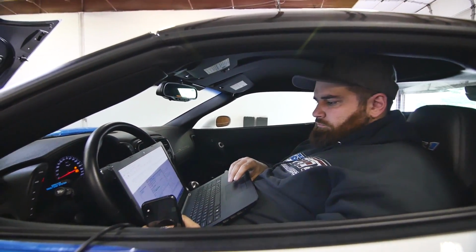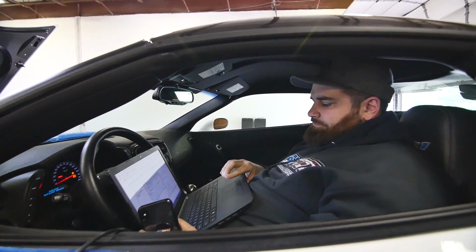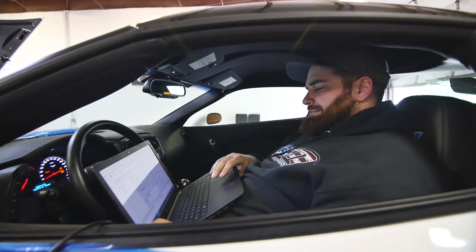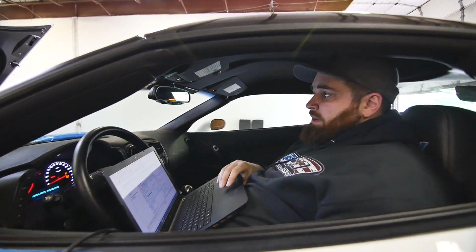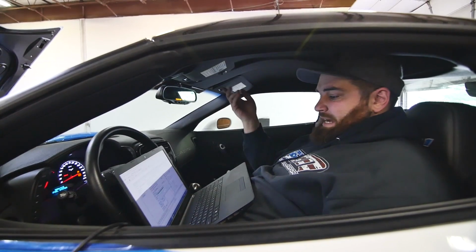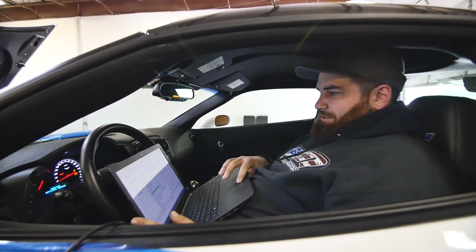One of those things that we always tell people to bring in a car is don't put injectors in a car, start it, drive it. The internet seems to do that a lot. I've seen idle clips where people put injectors in, the car's running, untuned. If it's on the same injector that it has, like stock injectors in a Camry, you can start it, but don't change the injectors and start it. It's not even really good to do an air intake like this and start it. This thing was adding 50% fuel through the O2 millivolts to try and compensate for how much bigger the air intake is. That will work, it won't hurt anything, but it's not the correct way to do it. But don't put injectors in and start a car.